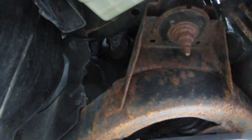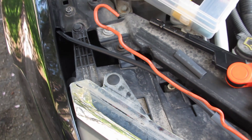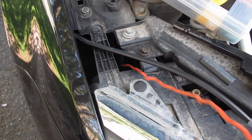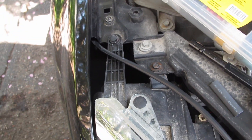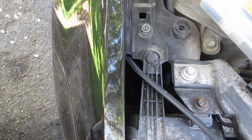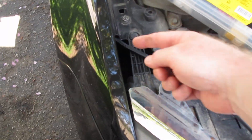What I did is I unhooked it from the reservoir, which is right underneath — where that stream is coming out. The black thing is the pump and the hose is hooked up there. I took a piece of 12-gauge wire, made a little hook on it, went in there, and pulled the line out. Luckily the nick was within an area that I could actually reach. The line comes up from the reservoir, goes underneath this fairing, and comes up right there, then down to the pump.